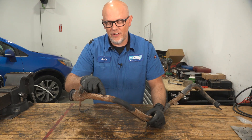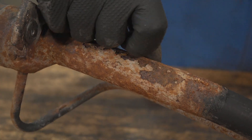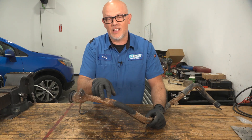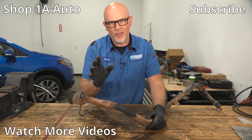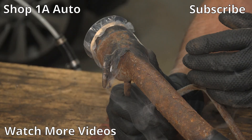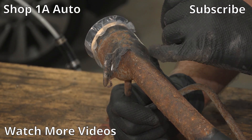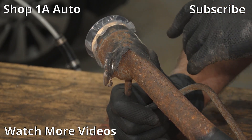You can see right here on the filler neck there's a lot of corrosion. You can actually peel some of the rust — some of that is a little bit of salt and stuff, and that's going to be porous and not create a good seal. So you've got to replace this; there's no fixing this. You can get this at 1AAuto.com. We hooked up a smoke machine to this, and right near the bracket we see smoke coming out. There's corrosion right there, and that's what's causing this leak.